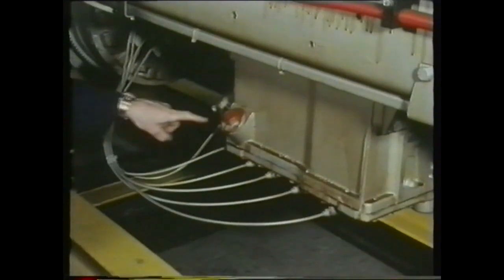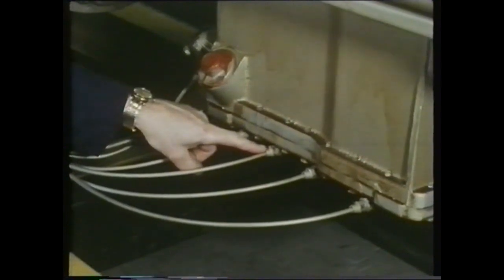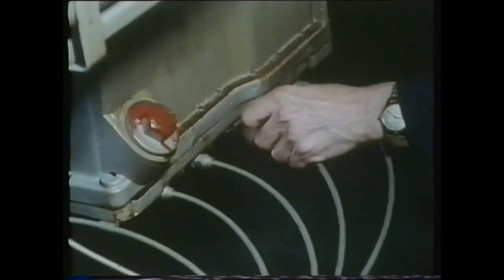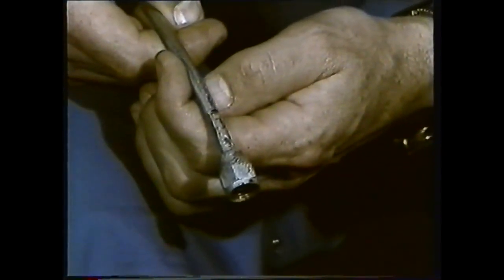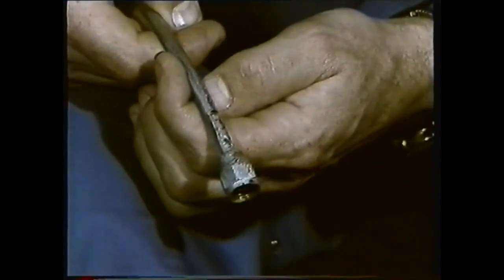If the fault is not cured by toggling, proceed in the following manner. This is the point where the air pipes from the EP unit enter the gearbox. It's here that you can establish whether a fault condition lies within the gearbox, or whether it's in the change speed system. With the air tanks of the vehicle in a charge condition and the change speed lever in neutral, release the air inlet line here that feeds to second gear. Now select second gear. If air escapes from the end of this pipe when it's released — and you'll hear if air is present — then the control system is functioning correctly, and it's therefore a clear sign that it's the gearbox that is at fault.